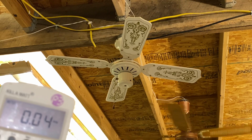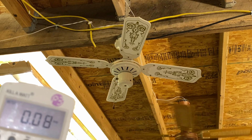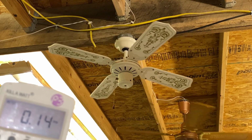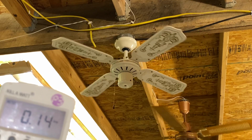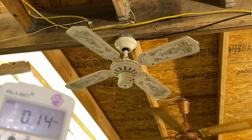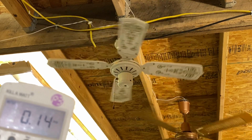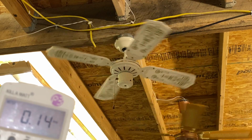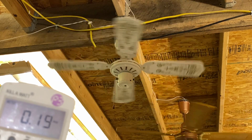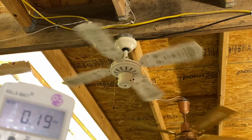1. Almost. Dang. 2. Might be a little stiff. Here's 3. Sometimes bearings are a little stiff with new in box stuff. Just a minute stiff bearings, so. 4. So this is 3 microfarads, and I'm already close to a factory low. Let's see what 4 is. Okay, so 4 is a little higher than the factory low.